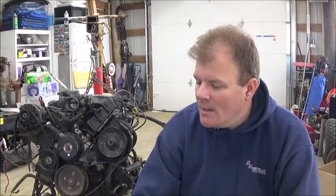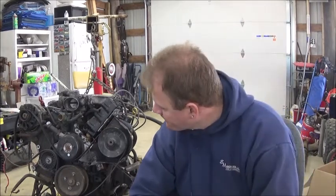Andrew wants to buy this car back once it's road worthy, and given that he doesn't make very much money, I'm trying to make it so he can afford the upkeep. I found a way to tune the ECU — I'm buying a laptop to do that. The turbo is just a plain Jane T3/T4 hybrid from eBay, a hundred-dollar turbo. I'm shooting for 200 to 240 horsepower. I'll need bigger injectors obviously, but everything we're going for is so he can afford to maintain it and just make a cool little two-two car.